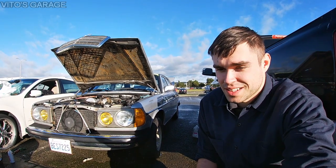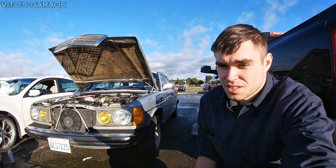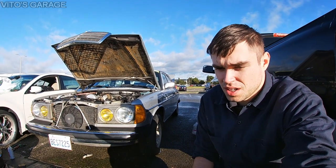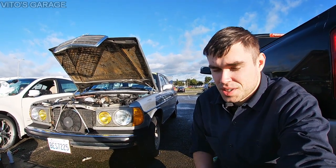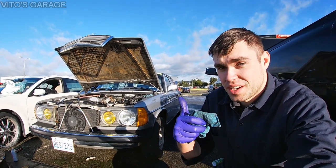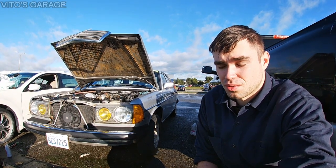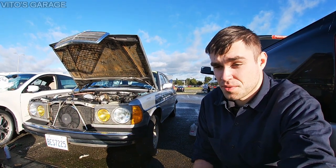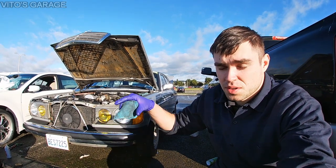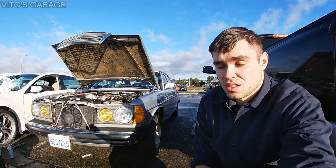You can do it, it's not that bad. And actually this also applies to other cars as well. At this stage, make sure you access your wiper assembly and lubricate it. Otherwise, if you don't do it, it's going to start rusting. The joints in there are going to start rusting and wearing out, and then who knows — it might stop working, or it will be really slow, or some of those joints will actually pop off. So you need to make sure that you get this job done.